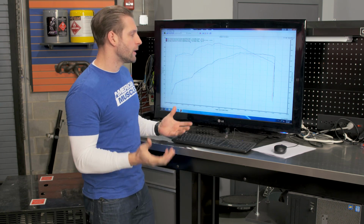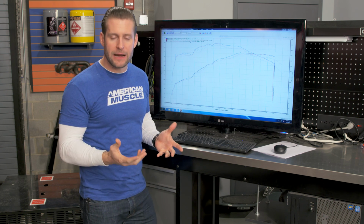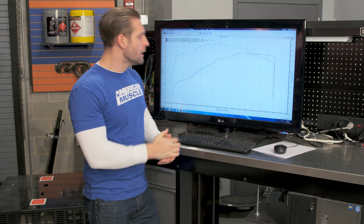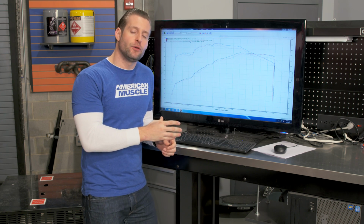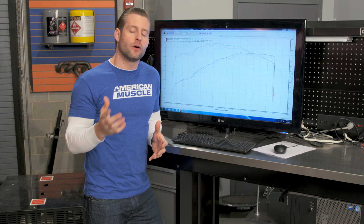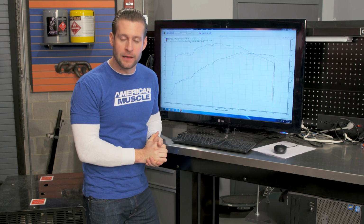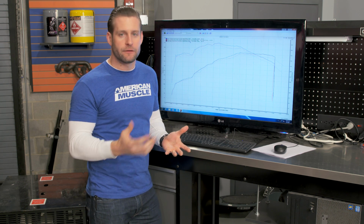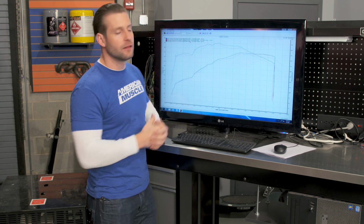Now guys, you're probably wondering why these tunes aren't making as much power as some of your other options here on the site, and honestly the answer is pretty simple. The Superchips options only give you a tune for 87 to 91 octane fuels. They don't offer a tune for 93 octane, so as such they can't get as aggressive with things like ignition timing, for instance, or air-fuel ratios because of that lower octane fuel.